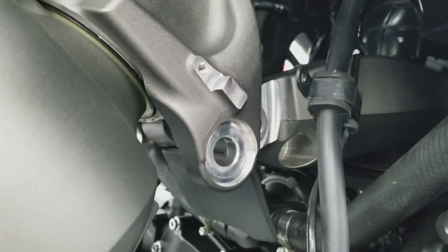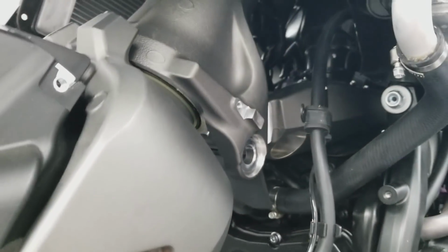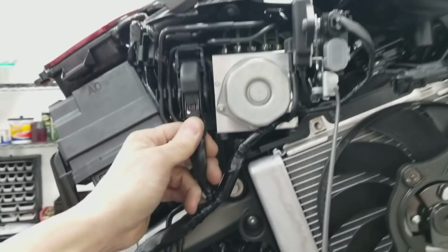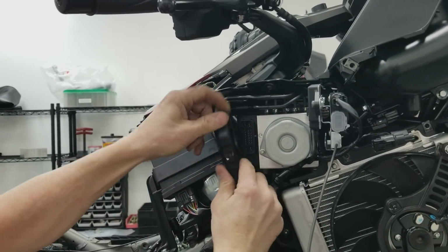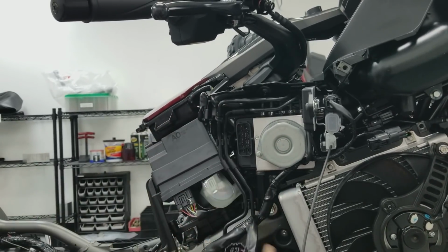Be very apparent. What isn't apparent is the upper one. So come around this side here. I had told you about pulling away a big block connector. So this is the large block connector that we're going to remove. It's got a lever on it. You'll push this tab, release the lever. The lever swings up like a cam, and then you'll pull this away.